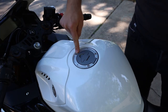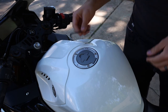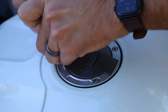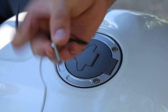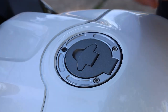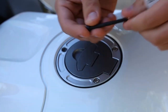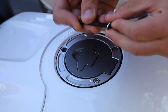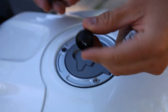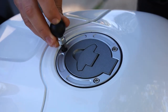The first thing we're going to do is just take out this little screw here — it's going to be on the top side of your gas tank and it's that four millimeter Allen screw. So you just loosen that up. You're going to want to save that for later just in case you ever want to go back to the original setup or take off the GoPro if you're going on a track. The next thing you want to do is take that 55 millimeter bolt, put that washer over it, slide that on, and then grab the ball head — just this one, not the one for the GoPro end — and slide the screw through there and retighten it back down.